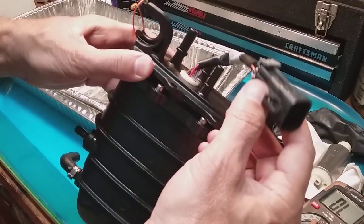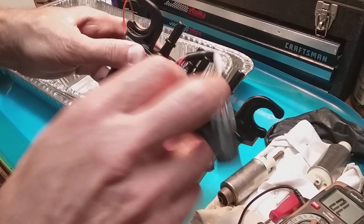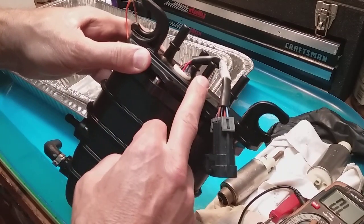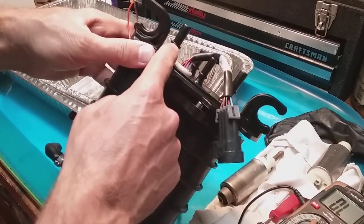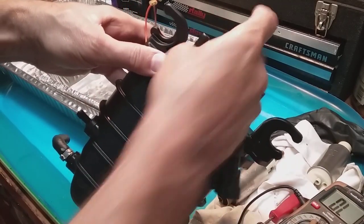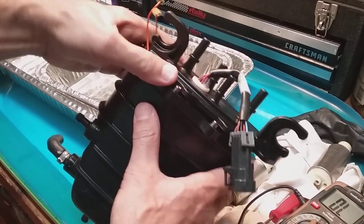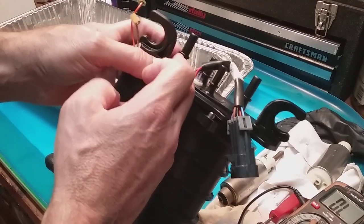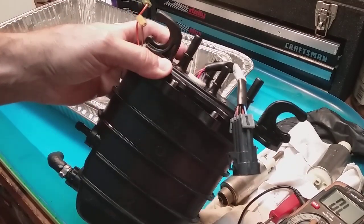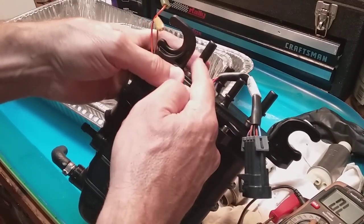The rest of this is super easy. You've got your harness — you only need to get out one bolt and then you can wiggle it out. This is like a vacuum hose, and I always hit them with WD-40 and then pried them up with one of these tools so I don't hurt anything. These are the clip-on plugs. You push the button well enough — there are red and blue ones. Just take a picture before you take it apart, and if you push the button enough it's going to slide off like nothing. I was actually using a screwdriver just to get in there and make sure I pushed the button well enough.